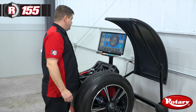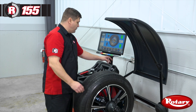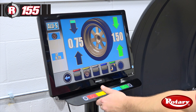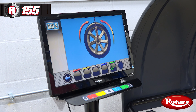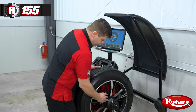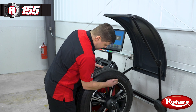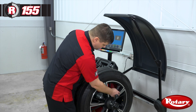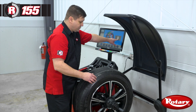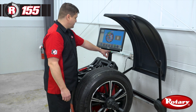Then I'll press the green button again. This is our outside — there's an ounce and a half of weight, but I want to hide them behind the spokes. So I'll press my right arrow and press the yellow button that corresponds with the split spoke icon. I'll rotate any spoke of the wheel to 12 o'clock top dead center and press OK. Then either spoke next to the one at 12 o'clock I can rotate to 12 o'clock top dead center. This number indicates the number of spokes in the wheel — it figures that out automatically. There are five, so we'll press OK again.